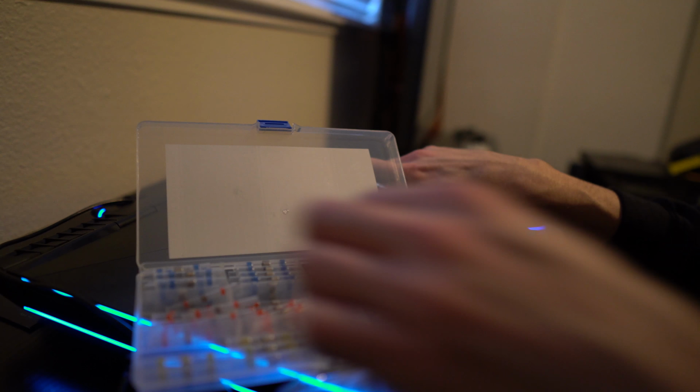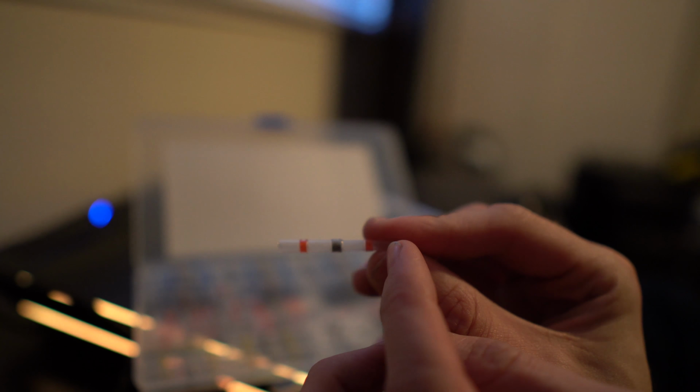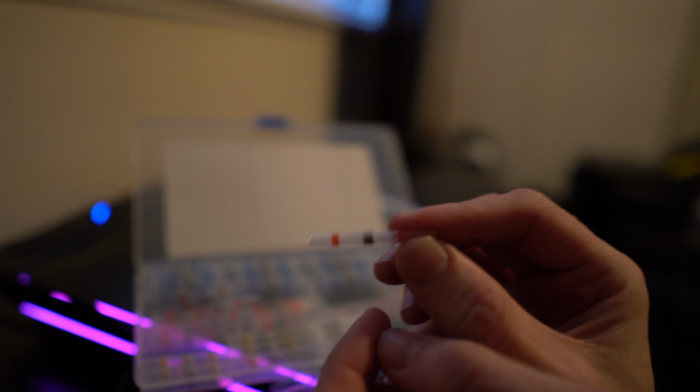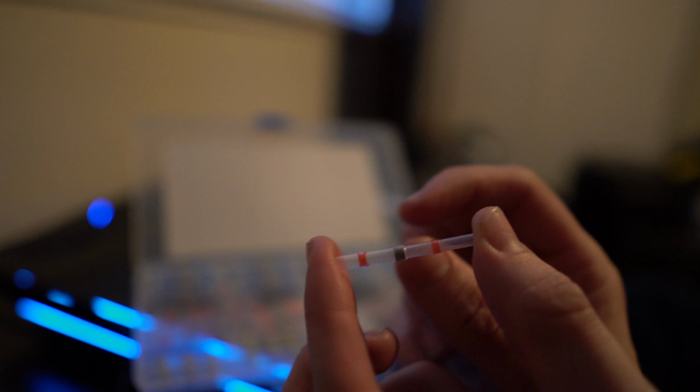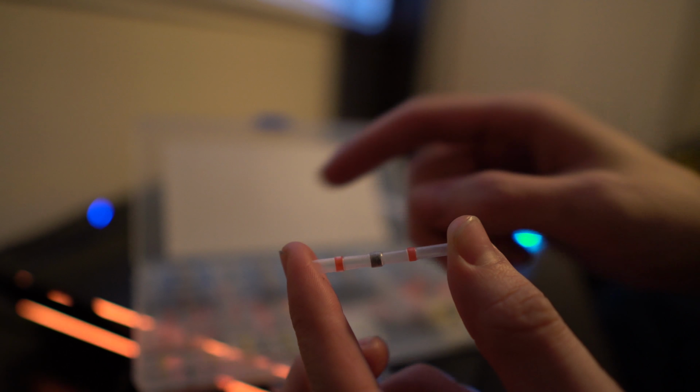View these. So these are another heat shrink item. These are so killer because you don't have to do butt connectors, crimping, uncrimping, making sure you got the right everything in there. All you have to do is line up the 2 wires inside of here. You'll heat this up, there is actually solder in here, and then these 2 little guys will hold the wire in place. So you heat these ends in first, make sure the wires inside of here are touching each other. And then once you've got it held in with these 2, then you'll go straight here with your heat gun right in the middle of it. It'll make a soldered connection instantly.